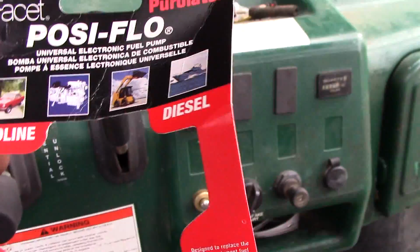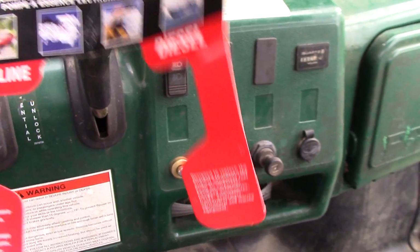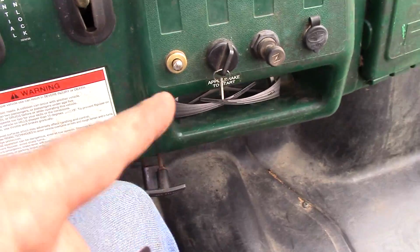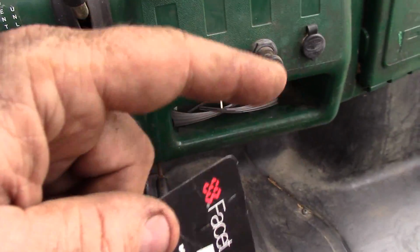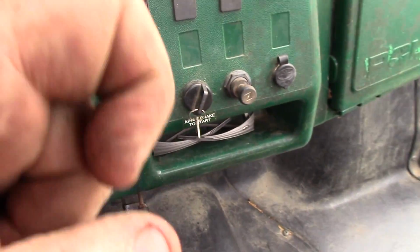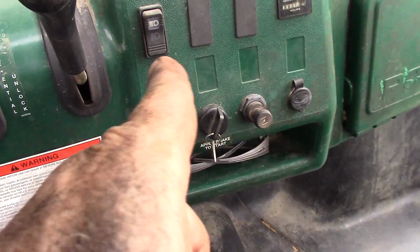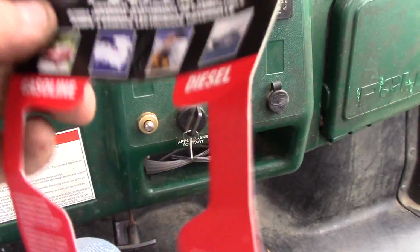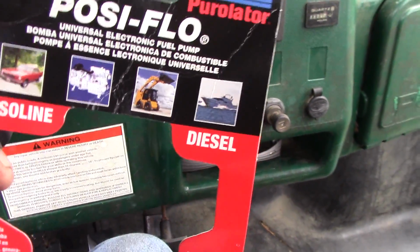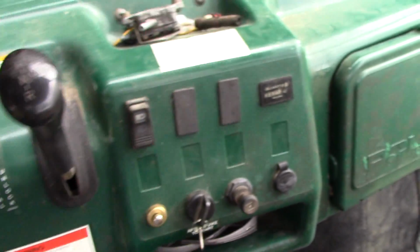I hooked it up, and like I say, that third pulse line, that third one, down where it goes under the engine, I cut it off real close, put a bolt in it and a hose clamp, and just plugged it off because I didn't have one of them rubber nipple things to go over the metal tube sticking out of the engine, but it's fine. There's not really any pressure there. You just don't want it to get dirt or anything in there.